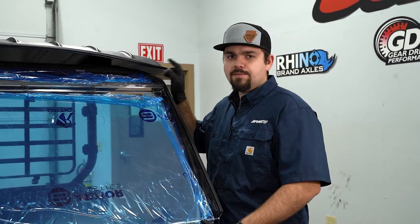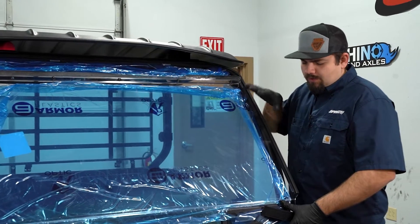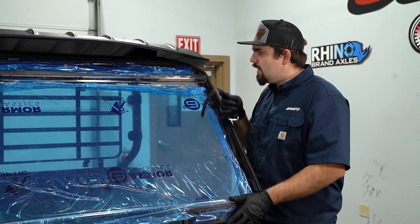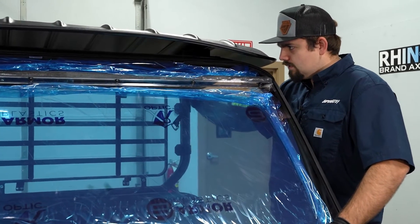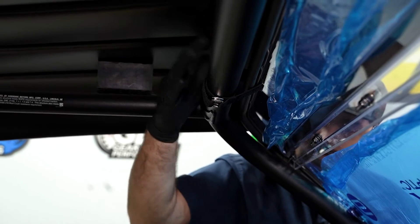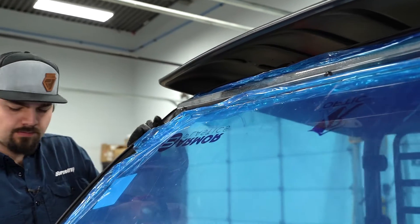Go ahead and remove the front two roof clamps if you have the factory roof installed. We put a dead blow and a little lifting block underneath our roof just to keep it up out of the way — you can fully remove it if you want, you don't have to. Once that's done, grab your windshield — it's all prepped and ready to go. I like to leave the protective film on while moving the windshield around so we don't scratch it. Grab your straps and run the top straps through first. Go up to the inside, flip the strap through with the velcro facing out. Slide the windshield all the way up into position and loosely strap it up top to get it to stay in place slightly, then do the same on the opposite side.